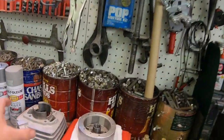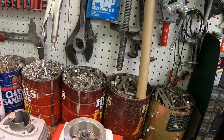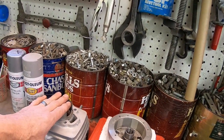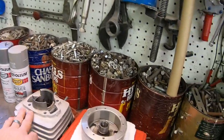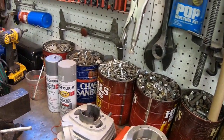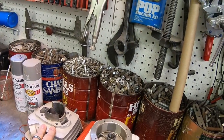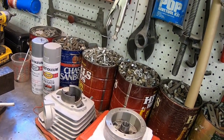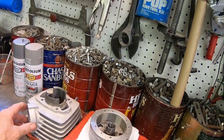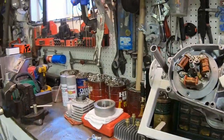I've got the cylinder sitting here and the head. Got the bolts replated. I need to hone the cylinder yet — I think we're gonna be okay. I'm going to do the measurement on camera so you can see kind of how that works. This is the spare engine cylinder that I'm going to use on this. I did a quick check right after I tore the engine down to see which one I was gonna use, and this one is definitely tighter. I don't think I need to bore it — it's gonna be kind of borderline out there, to the max on the piston-cylinder gap. But it's gonna be okay. It's probably gonna run about two, two and a half to three — something like that. And I think 2.8 is the spec. So anyway, we've got another little piece of the puzzle back together.